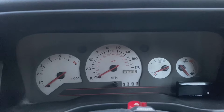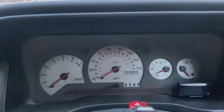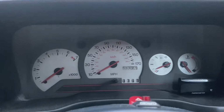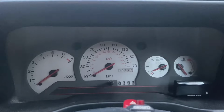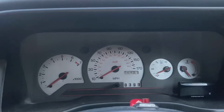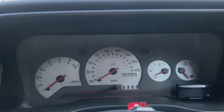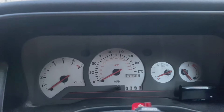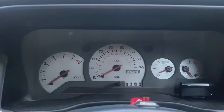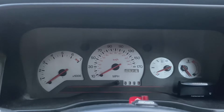The clocks, if you remember, had a boggin' orange colour when I turned the light on. They're supposed to have an inverter, which runs to a plasma, like a luminescent back film for that. It's all there, but I don't have the inverter for it, with it not being a genuine Cosworth. You can do it, and there's a way around it, but I'm going to try these bulbs first as a temporary measure before I obviously buy the other parts.